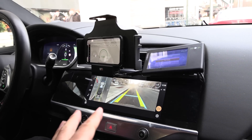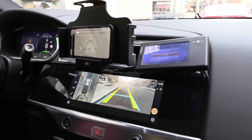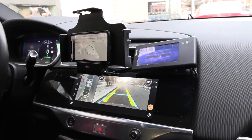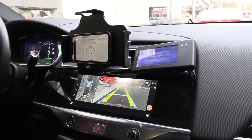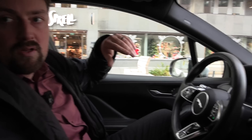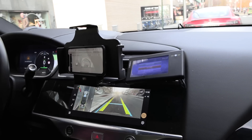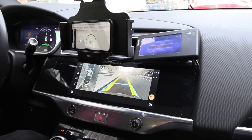If the car moved on its own for some reason, the system is constantly measuring the coupling between the pads — if there's any difference in coupling it will shut off. That's also why there's an alignment tolerance zone of plus or minus 10 centimeters in all directions. If you're outside that zone it technically won't allow you to charge. Inside that zone we can be more than 90% efficient.